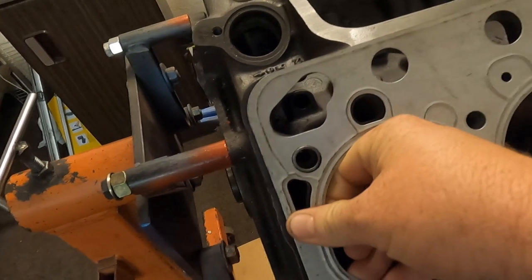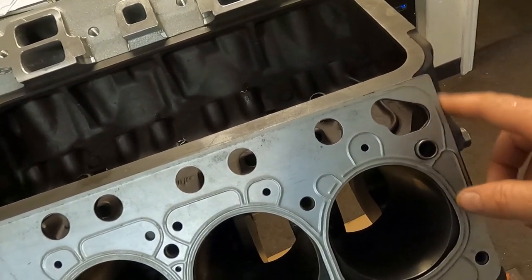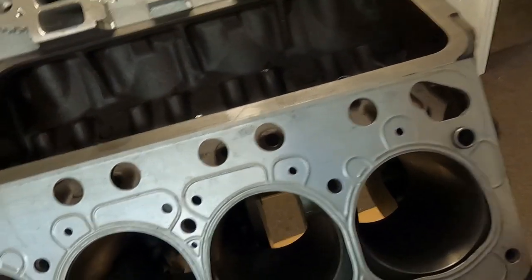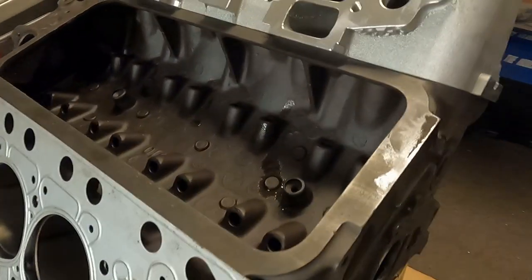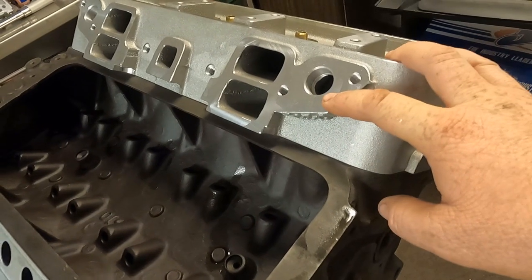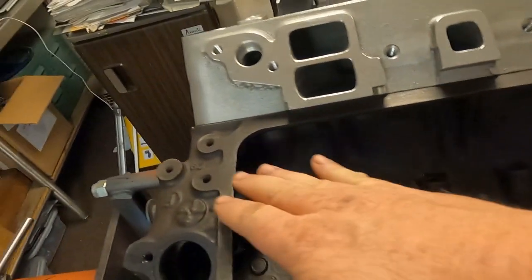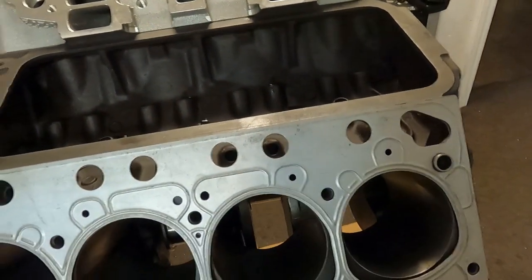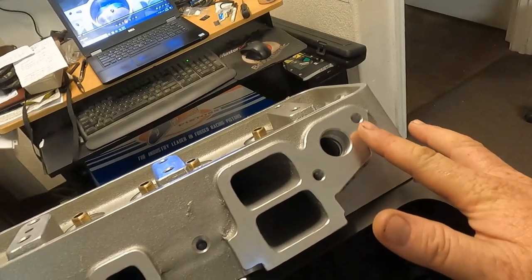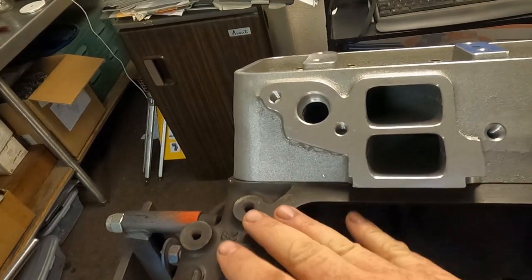The main thing you want to look for when putting your head gaskets on is the front markings — those are nice to read. A lot of times the OEM styles have the square corner in the front. But if you don't have the word 'front' and you don't have the square corner, then what you do is: you want to know where your water enters the block, where your water leaves the engine, and at that point you have to look at where your main water ports would be to allow a complete established flow through the whole circuit. Essentially, that is at the opposite ends of your inlet and outlet — that's what allows the complete horseshoe effect, with the main water transfer from block to head at the opposite end of your inlet and outlet.